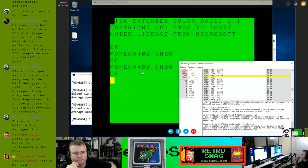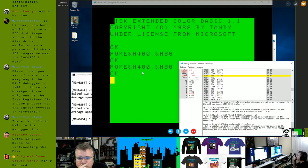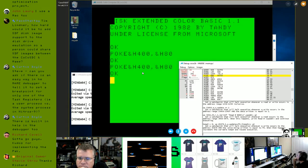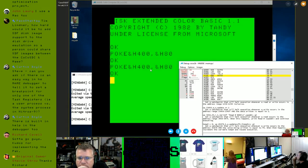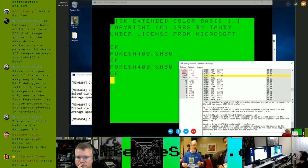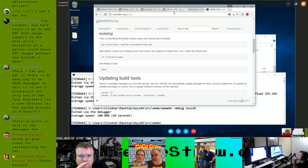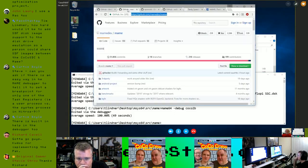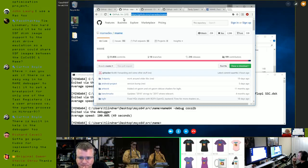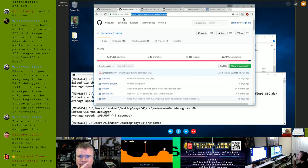Interesting. It would all be based on whether the software switch was already being used in the Dragon hardware. Mm-hmm. To my knowledge, it's not. You might have, on the 64, it's copied to run in a RAM mode. You might have some conflicts possibly there, but you shouldn't have, running in a standard 32K mode. You may not have in the other mode. That's just the only thing that I could think that would do that.